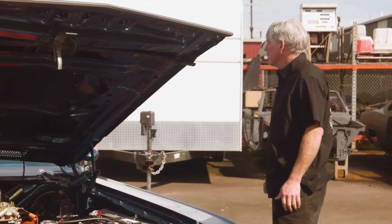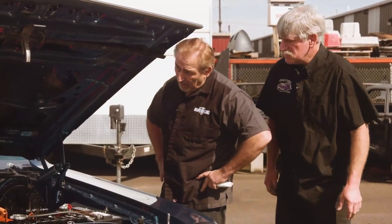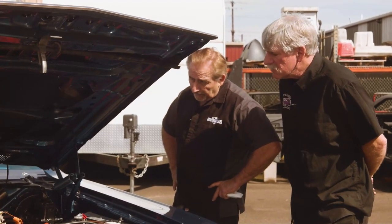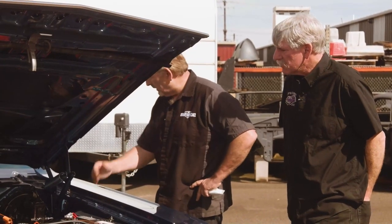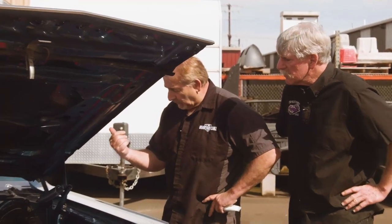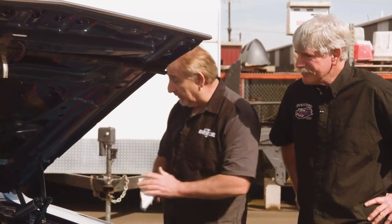All three gauges pegged, and it hasn't ran long enough to do that. So we have something inside there on the wiring that's not right. Probably, it could be the CVR, the constant voltage regulator, stuck wide open. You run it very long like that, and it'll cook those gauges. Gotcha. But the engine runs good. That's very important. I want you to check the CVR inside there. If we can get that fixed, we'll fire it back up, top off the radiator, check all the fluid levels, we'll be able to go on a road test. But that thing sounded good.